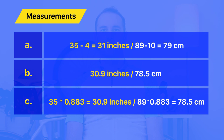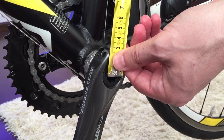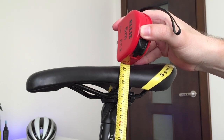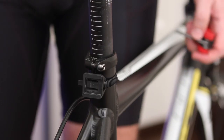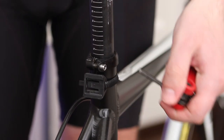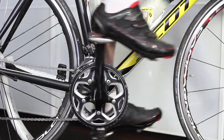The final results should be very close. Check my example with calculation. Measure the distance from the center of the pedal axle to the top of the saddle and tighten the saddle bolt. Make notes with the calculated saddle height. You can also check the seat post markings and try to remember them for the future. For a double check, rotate the crank with your heel, trying to reach the pedal — you should get it easily.